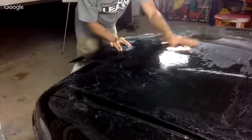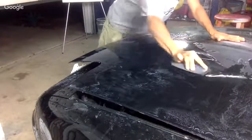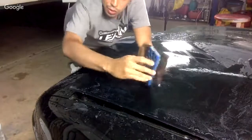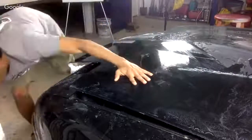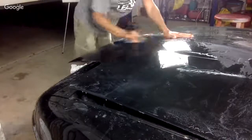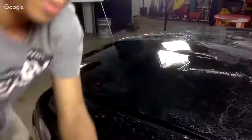And you see the hump here? There's a hump. So I'm going to go on an angle on the hump like this because that's the only real way to do it. Okay? So you go up and down the hump and you're using the corner of your block here. Then you can switch up your paper like this, from here to here, to get a new fine grit, close it up, wet it down again, and just keep cranking. Okay, so I'm just going to basically sand out what I sanded really quickly. We'll be done in just a couple of minutes here. Let me get up here a little bit more.